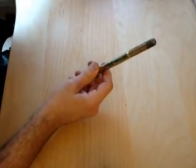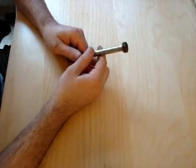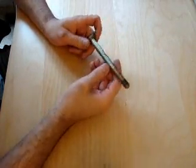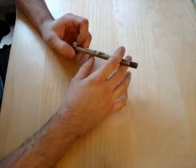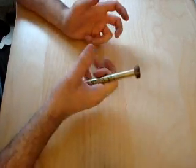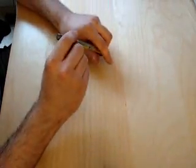Here's the difficult part. My car has an automatic transmission, so there's really not a lot of room to pull this bolt out. On the passenger side, you can maneuver it out, but on the driver's side, you actually have to take the trailing arm off the hub carrier, rotate it, and that way you can dump the bolt out.